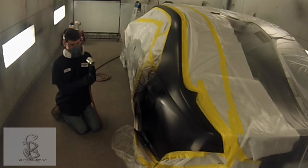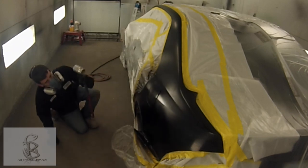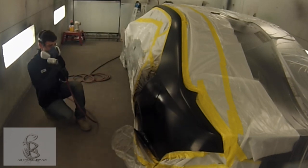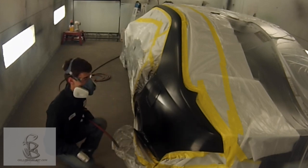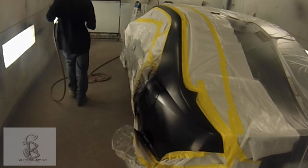With solvents you have to wait anywhere from five to 15 minutes depending on the product and brand, and waterborne eliminates that. They also do have booths — we just have a regular downdraft booth, but they do have booths made for waterborne now where you don't have to sit there with a handheld blower. They've got blowers built into the booths or fans, and that comes in handy.